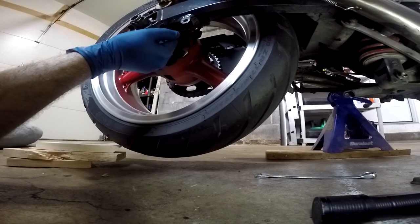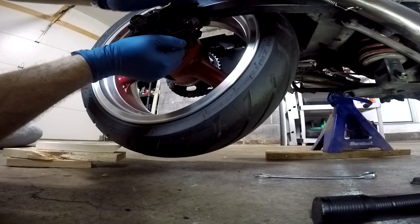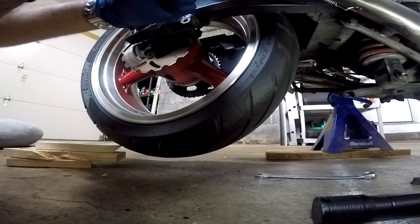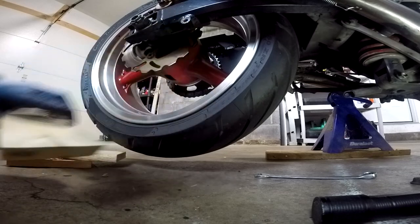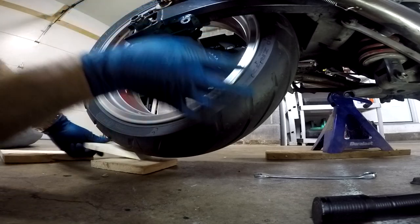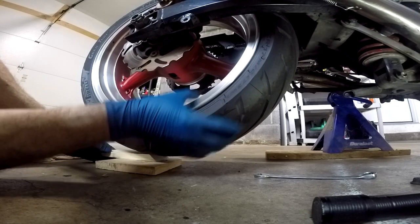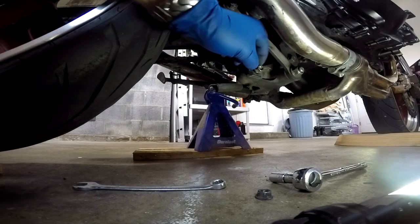Although we took the weight of the bike off the swing arm, now that we've lifted the bike up, the weight of the wheel and swing arm is actually pulling down on the shock. So now we have some weight on it in the other direction — but that's easy to fix. All you've got to do is get yourself some wood blocks, some shims, just some junk wood you have, and kind of shim up the rear wheel. Just tap some blocks in to lift it up and take the weight off that bolt. Now you should be able to pull that bolt right out.